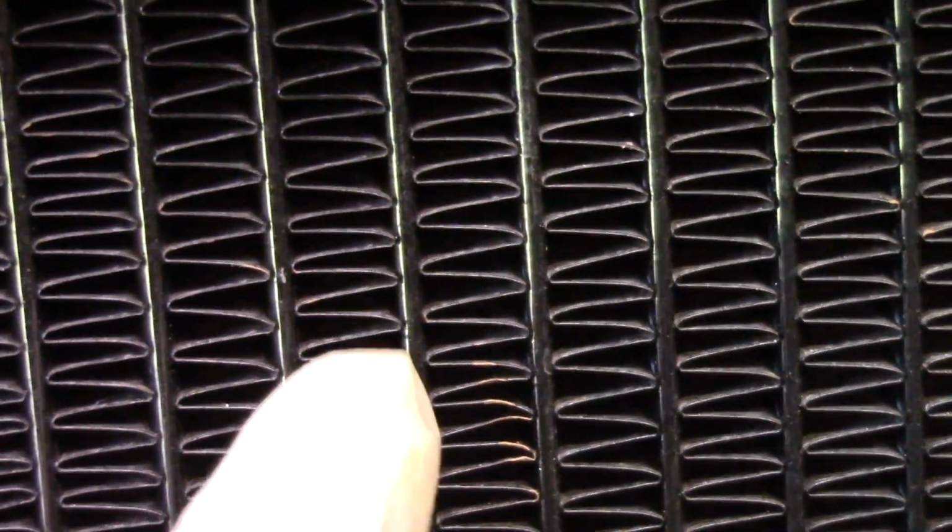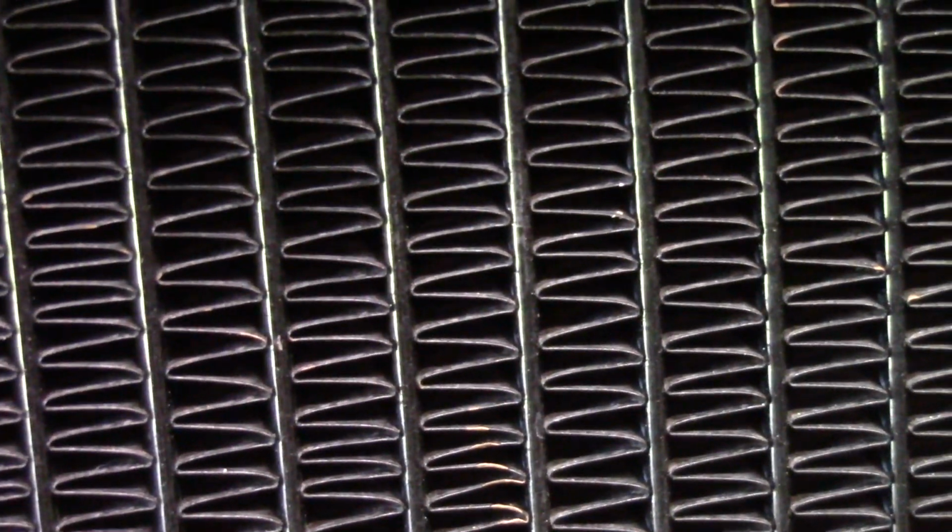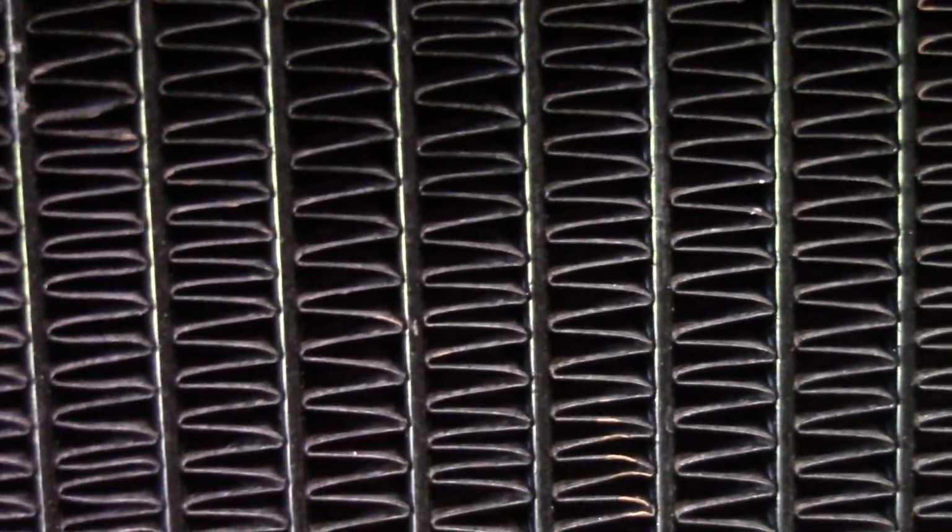So, that's an interesting thing. And by the way, these things are 100% welded. It's aluminum with aluminum. Because copper is so fragile, they solder the fins to the tubes. And the solder actually makes the fins far less efficient. It almost takes it down to the efficiency of aluminum, because the heat transfer through the solder is not nearly as good. So this is going to be really interesting.